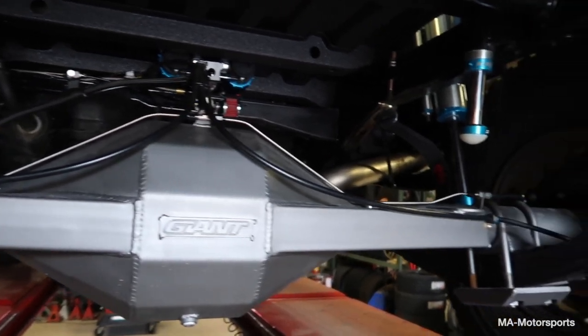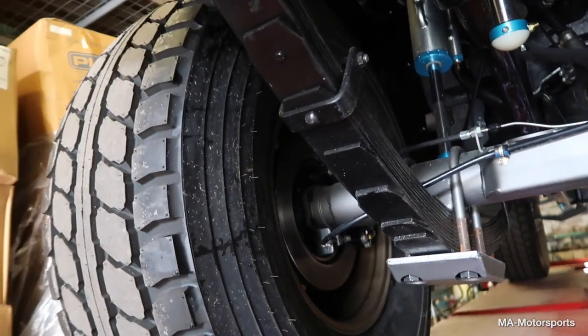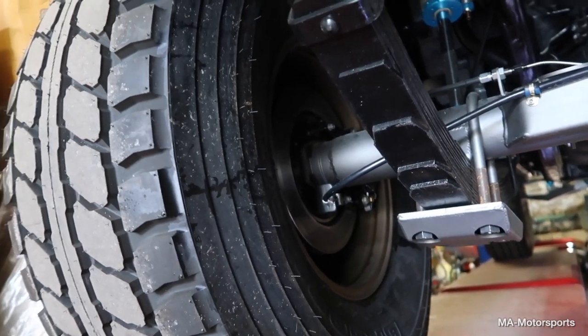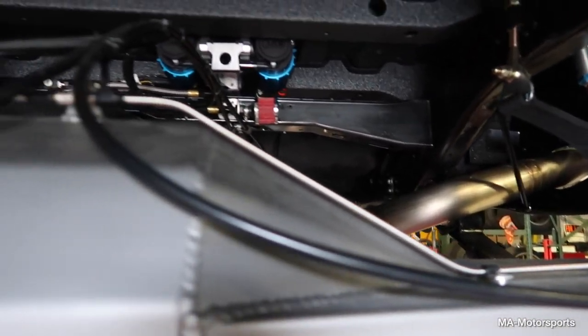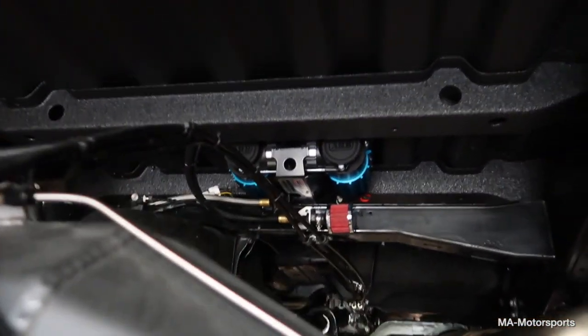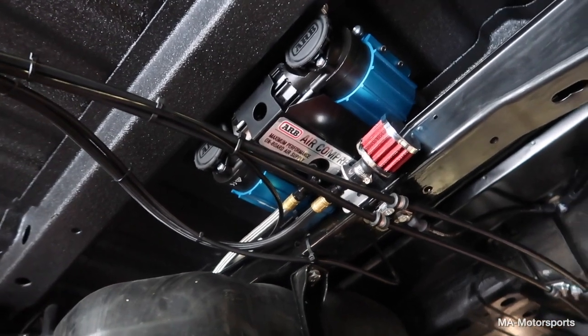Very nice units — there's a big truss on it. We made the truss just wide enough to still clamp the leaf springs with no problems. It uses a Wilwood brake kit — off-the-shelf, and one of the cool things for a street-going truck is the ability to add a parking brake, which we did. That's what the black cables are. All brake lines were routed in-house, nice and tidy with plenty of slack, running up to the chassis and into the cabin. Up there you can see the air compressor for the air locker, controlled by a switch in the interior.